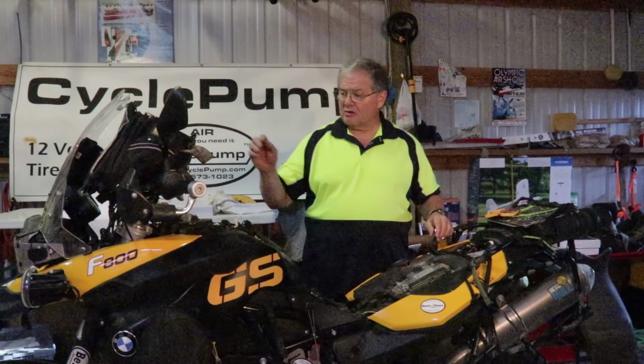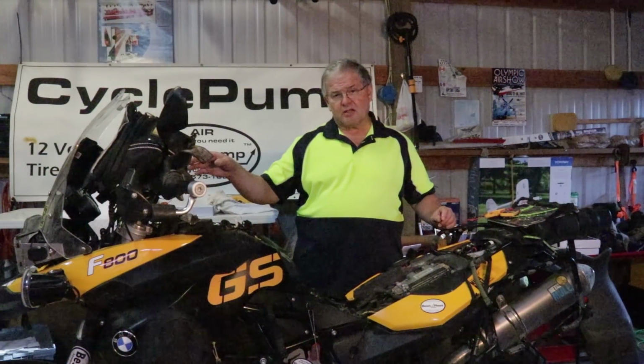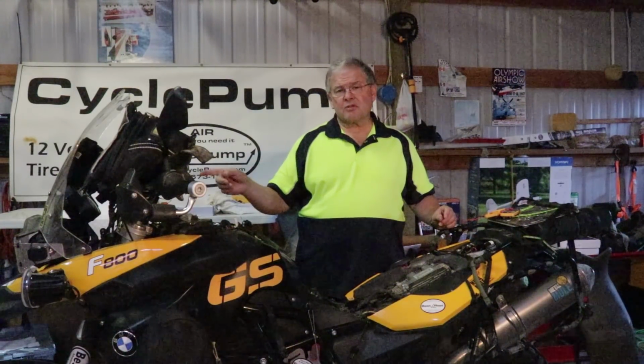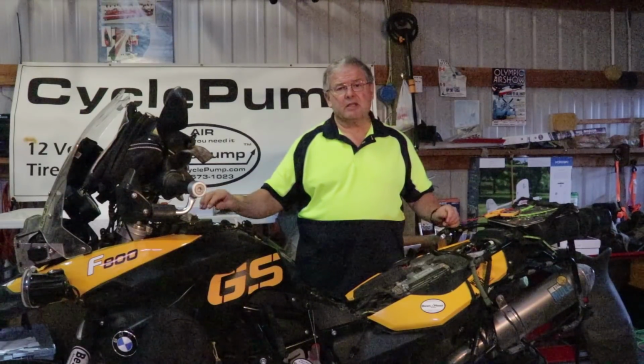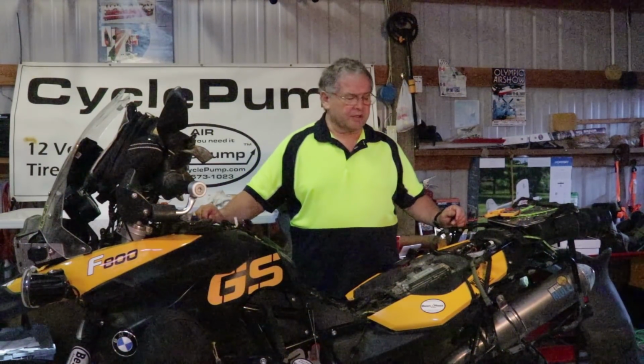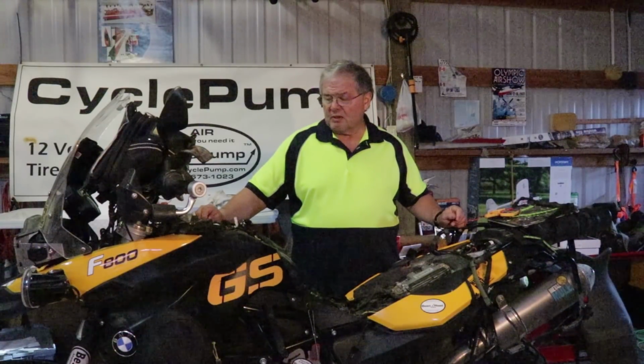We're not going to go into all the bike details, but some common sense will apply. You have to get to the tail light assembly so that you can tap into that brake light hot lead. That's going to control the system in the back. And again, in the front, you have to tap into a hot lead that is turned on when the ignition is turned on. I didn't hook to my low beam light because that only works when the engine is running. So I ran off of that auxiliary little running light in the headlight, and you saw the stills in the movie earlier. But it's been a good setup.